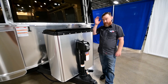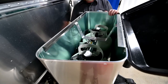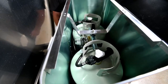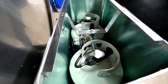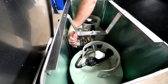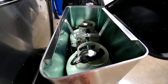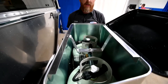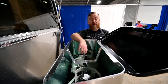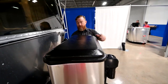Under this silver cover is where we'll find your propane tanks. You've got 30-pound propane tanks on this trailer and they are already full. In between is an automatic regulator — if you've got both tanks open, when one tank runs empty it'll automatically switch over to the other one. There is a little post on this regulator that you can point at one tank or another. However, there is not a gauge here, so I do recommend that you run one tank open and one tank closed, so that way when it runs empty you actually have to come outside and physically open the tank, making you aware that you're running on that second tank.